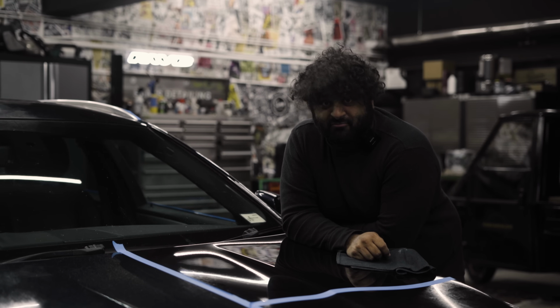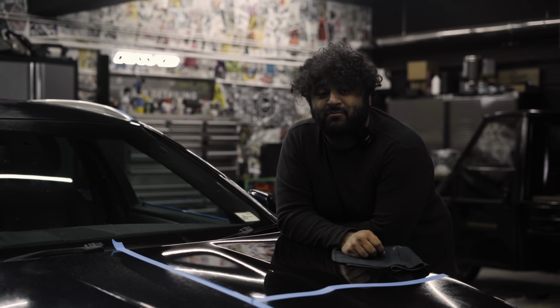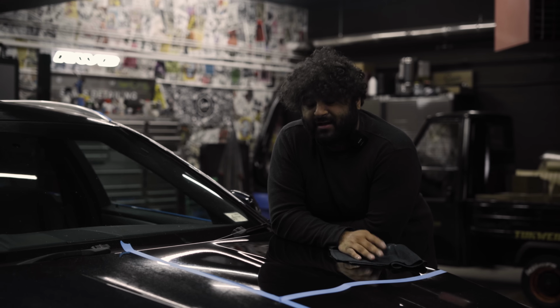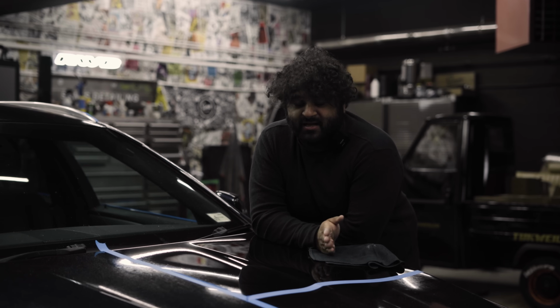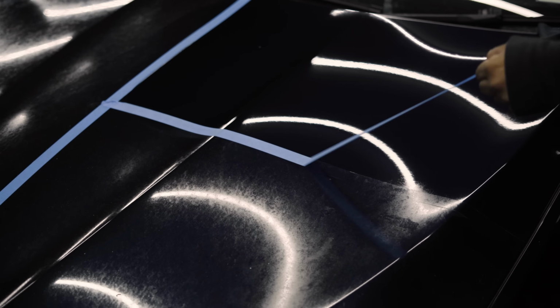So I had to upgrade to the 3M set, basically body shop polishes, which are a bit more extreme and designed for bodywork. And so I ended up quite literally having to go to an aggressive pad with an aggressive polish just to cut away not only the dirt, but heat up the lacquer enough so it levels off again and we have a nice shiny finish now.